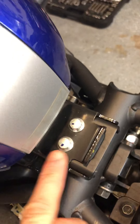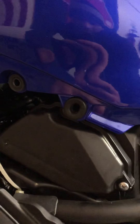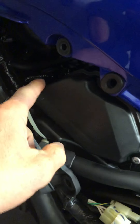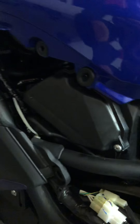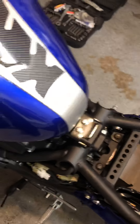Just wanted to add one more thing — you actually don't have to take off these two bolts right there. I took off these bolts right here as you can see. I'm gonna use these rubber grommets again. One of the reasons why this usually takes me so long to put the tank on is because at the same time I've changed this filter. There's a filter right inside here on the side — you might as well do it at the same time. I put a K&N filter on. I'm just gonna take off this last bolt right there, the tank will come out, and I'll put on the new one.